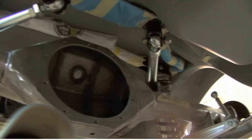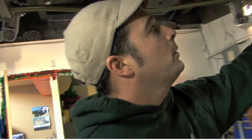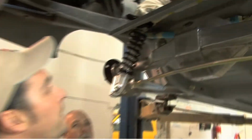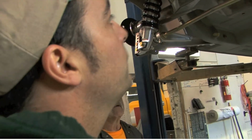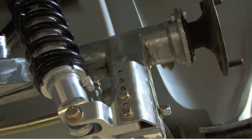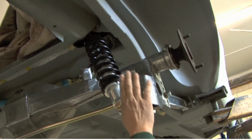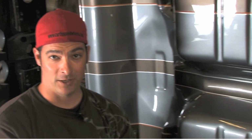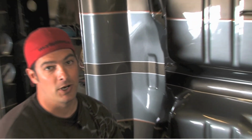We've got a tubular arm here. We've got tubular front arms. What we're going to do is probably end up getting a tubular arm for the lower here so that all the suspension components have some continuity. That's a lot of the stuff we look at. We look at stuff like the square differential. That's going to need a JF Customs revamp. It's just going to have to look smoother, rounder. We're going to have to get rid of excess holes. You can see by our style of car, we always mount the suspension at the lowest points on the mounts. That way the differential is really high up. That allows us to fit big tires, lower the car. When we're fortunate enough to have a customer like Gord that actually challenges us to do better work than we've ever done in the past, these are the results, and we're pretty proud of them.